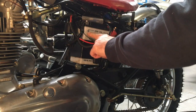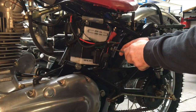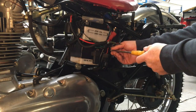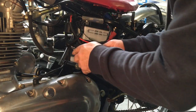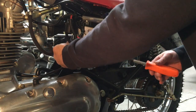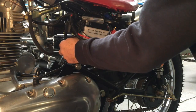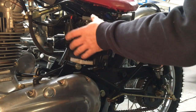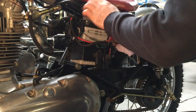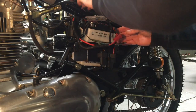This is the negative terminal, which goes to earth — black and negative. That's the red one, it's positive. Now I can't get to that screw there because of this bar, so we'll just release this bracket. That will allow us to just pull the battery forward a little bit. That's two screws holding this in. Now I'm going to pull the battery forward so we can get to that terminal. I'm just going to lean that forward and put this cloth behind there to hold it in place while we're working on it.